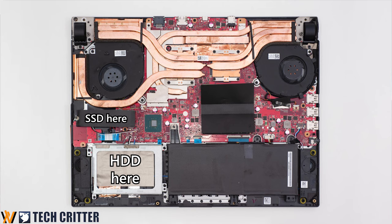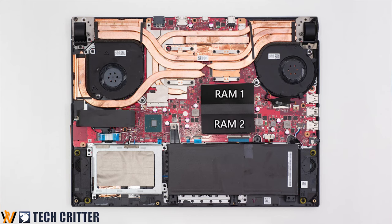The silver lining is that ASUS made it really easy to upgrade the ROG Strix Scar 3 — just open the back and you get access to the M.2 slot currently occupied by the Intel 660p, and there's also an extra 2.5-inch storage bay. In the accessories box, you also get a kit with a ribbon cable to connect a hard drive and screw it in yourself. There are also two RAM slots; our review unit has been upgraded to 2x16GB, but off the shelf you only get a single 16GB stick.